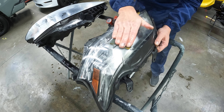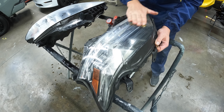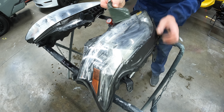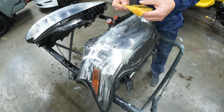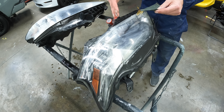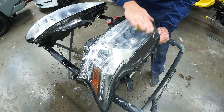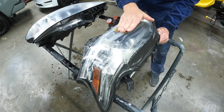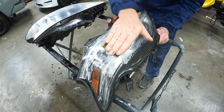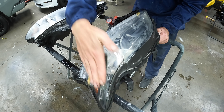We're going to repeat it on the next light as well — same thing we did. These are not too terrible, but if yours are super yellow and super hazy you can use a coarser grit like 800 or even 600 if you need to, and then just level up. So you go 600, 800, 1000, and essentially you can leave it off with 1000 or refine it some more with 1500 — that's what I like to do. Look at all that yellow dirty haze coming off, fairly easily.